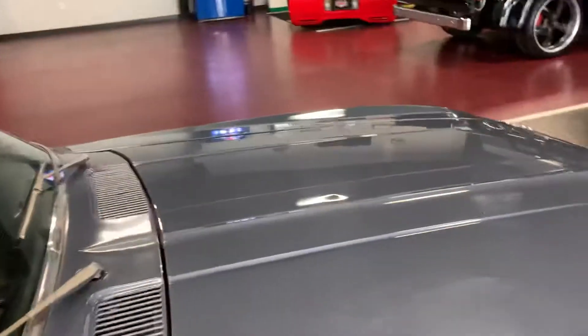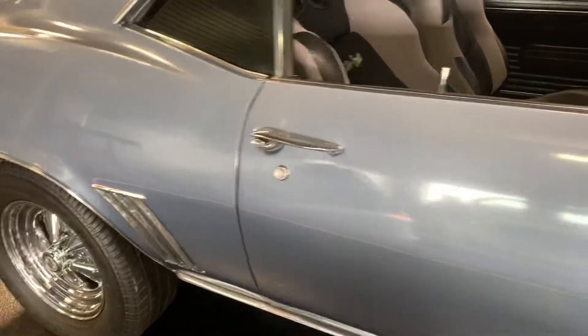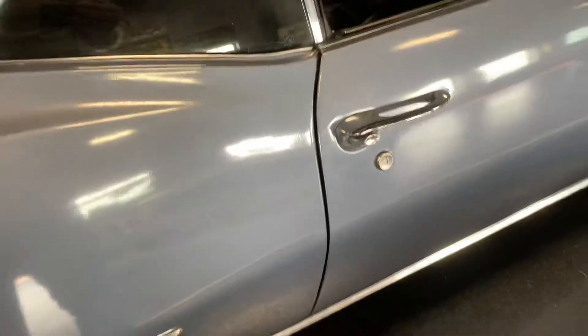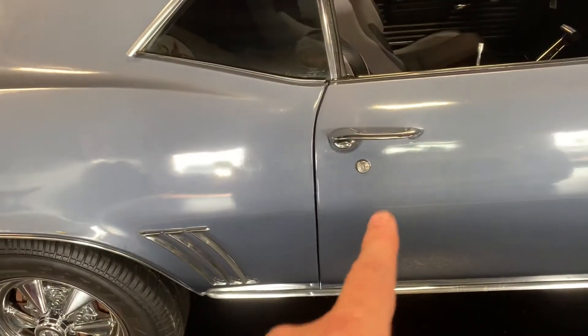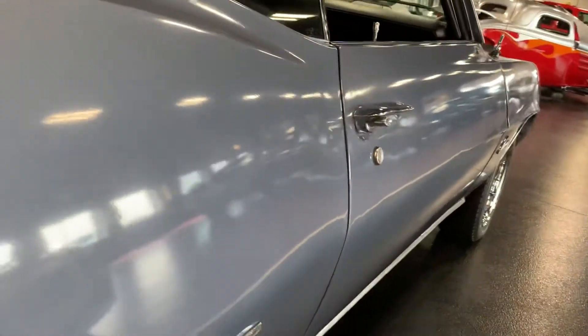Some white paint showing through here. As the description states, this thing was originally painted Dover White — this gray was done over the top about 30 years ago. Some white showing through here, stuff's flaking off. Everywhere that you see it flaking off, I rub it and it's nice and smooth underneath. I'm guessing they just didn't scuff it good enough when they shot it. From door to rear quarter, panel gap looks great — you can put your hand nice and tight on these rear quarters and those doors are nice and flush.